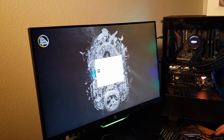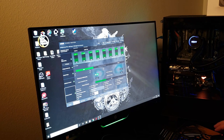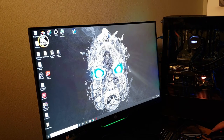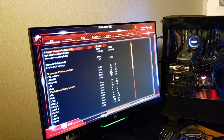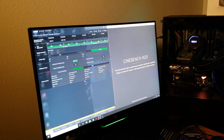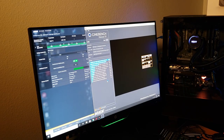First things first, I'm going to check Ryzen Master — and look at that, we do have each core running at 3.8 GHz. Our memory clock looks like it is quite a bit slower though. I'm going to hit the reset and see if I can get that memory sorted. I figured out what it was — I didn't turn the XMP to custom profile, I had it on a standard setting. So let's boot up and get this going. Still a stable 3800 megahertz. I backed off a little bit on the memory clock. We're sitting at a solid 38 degrees Celsius. The score to beat is 3325.